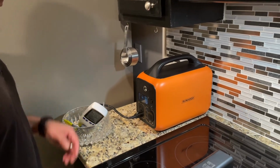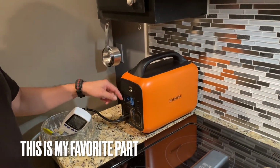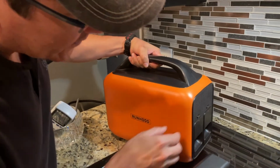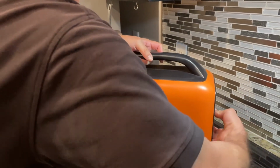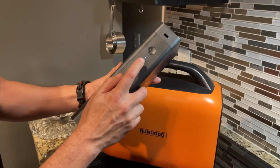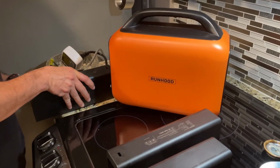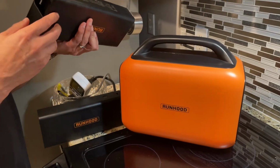Okay, so here we go. The fridge is currently running with the compressor on. It's still drawing 102 watts. So what I'm going to do is change out both of these batteries while it's still running to see how it reacts. So let's pop out one battery. And it does show that it's still got 3 lights out of 5. And it's still showing 48% charge on the front here, and it says 1 hour left, but again, it probably has more than that.